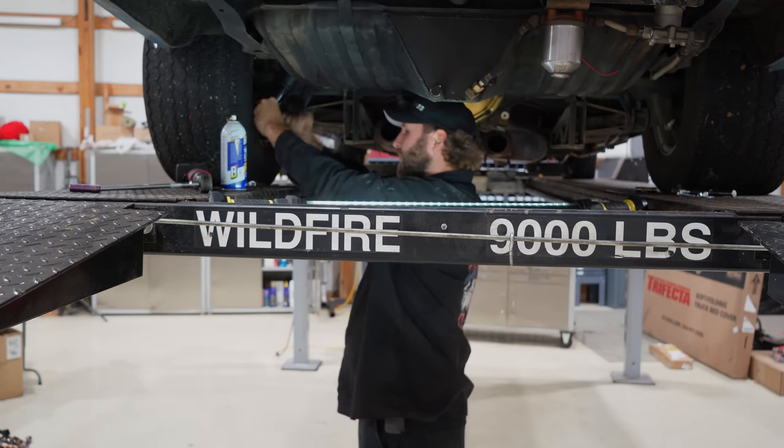It's just spinning. There's a broken lock washer in there. No washer over here with too short of a bolt. These bushings are completely hammered. Well, ignore the bushings. I can rejuvenate them.